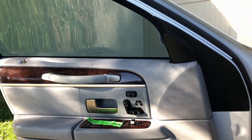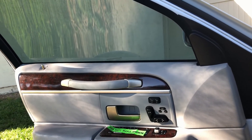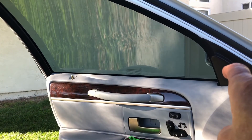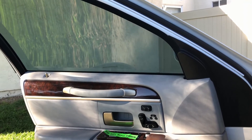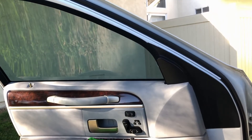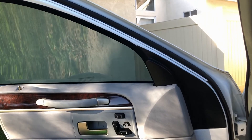I also cleaned all the windows. I had another video but for some reason my PC won't upload one beginning video out of all the ones I put together — drives me crazy. Make sure to clean those tracks on all four windows. I also took an air compressor and blew out all four doors, all the weather strip along there, and the back window. I opened all four doors and just blew all the dust out of the car, because if you have any little speck of dust on there when they put window tint in, you'll have a problem with the tint.